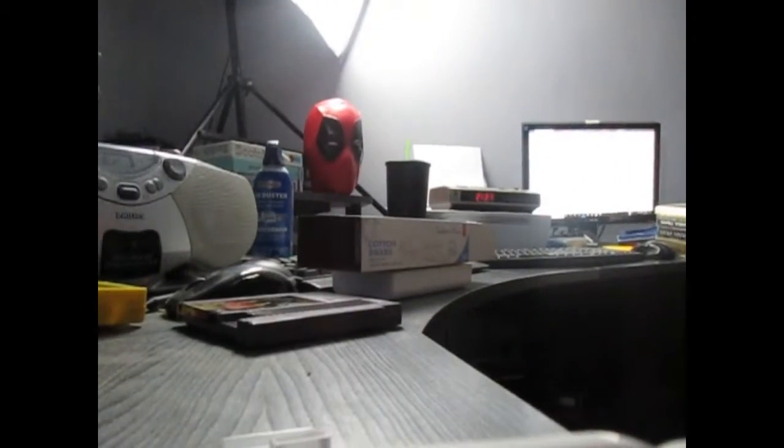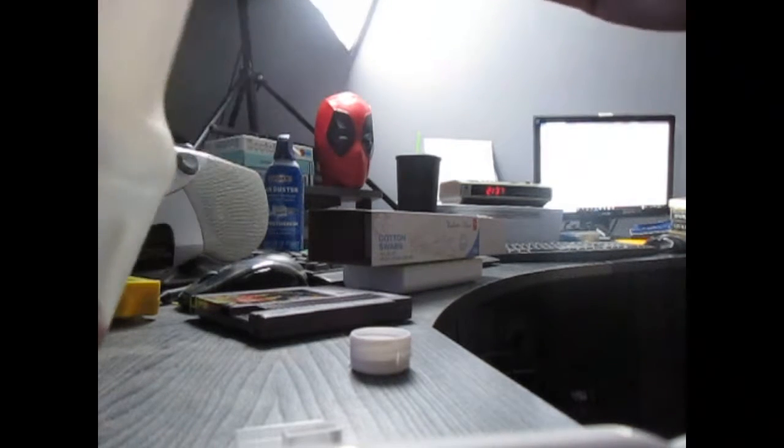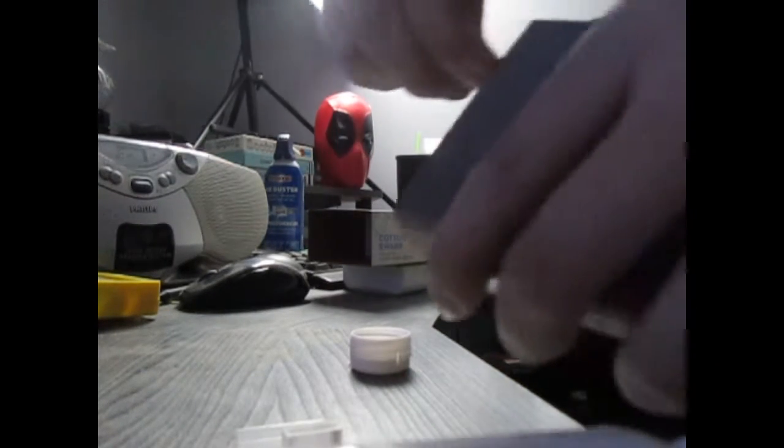In my previous videos I did this with the one-up cards, but for this one — make sure it's on there, nice and wet. Clean the top areas here. And so far it looks very clean on the top. Vinegar eats away at the corrosion. And often the corrosion buildup was, surprisingly, from people blowing on the cartridges — after a while that builds up corrosion because the mucus builds up in there.